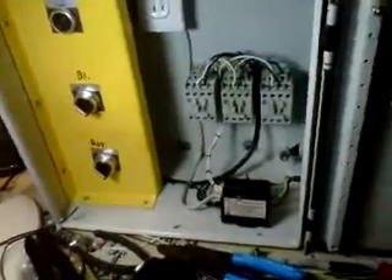I'm looking into an Agastat timer for the blower and rotator — essentially one of those like in the RCM1 panel for a Thunderbolt. That keeps the rotator and blowers both running for however long you have it set for; I have this one set for six seconds, after either the cycle is ended or you cancel it through the AR timer or AF if it's a 1003. I'll add that in and then I'll have the capability to run a remote AR timer for this, which would be kind of cool — then I could run a full cycle.